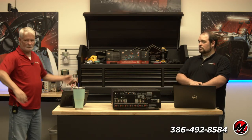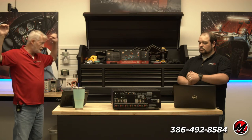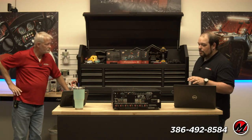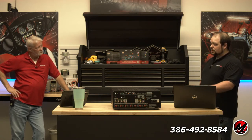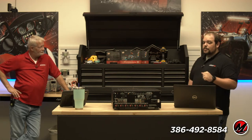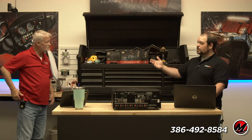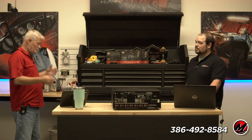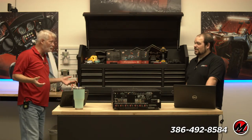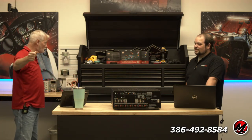Let's assume we have a decent-sized room, we're putting in multi-channel audio, it's not a full theater. Where do you start? I start with the AVR because the AVR is going to dictate what happens in the environment. Actually I start with the speakers — because of inventory, selecting an AVR right now is kind of out the window. I'm going to get whatever's available, so I look at the room, then the speakers. Am I going to do a 5.1, 5.2, 7.1, 10.1, or 9-channel setup?